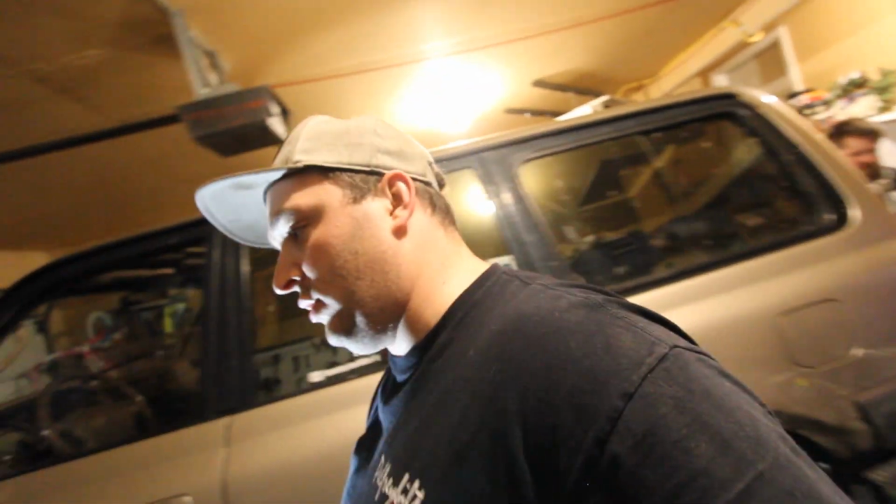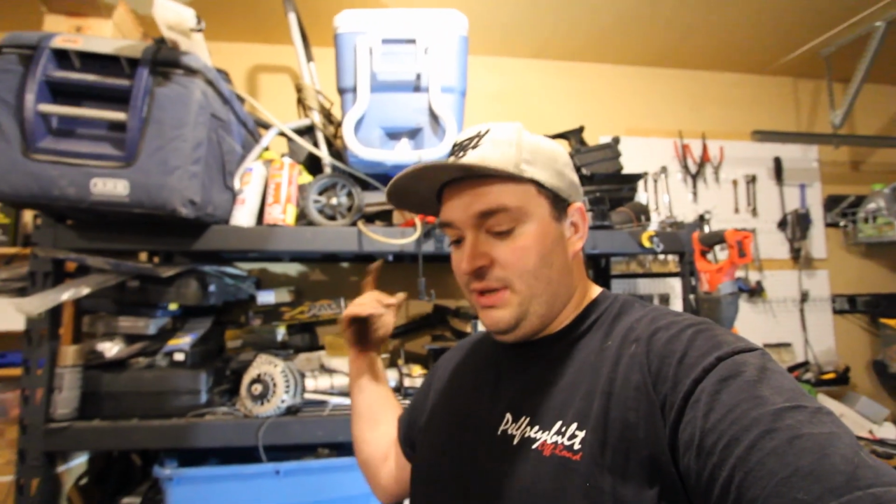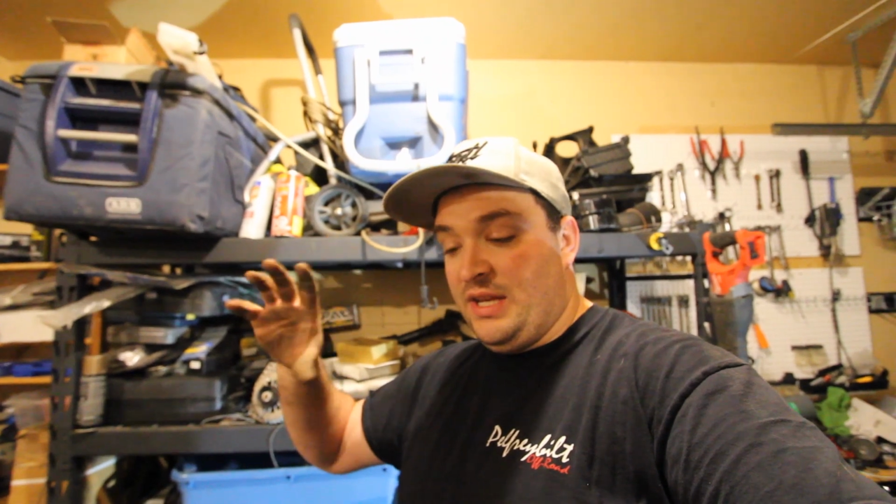I went with adjustable, guys, because I do know I need to adjust my pinion angle. I have a bit of too much pinion at the moment. Yeah, too much pinion angle for my lift, not enough, sorry. So we need to do some adjustment. At some point, that'll be another video. I'll get a pinion angle finder, and we will dial the pinion angle exactly the way we need it to be, so that way I get less rear diff vibration.